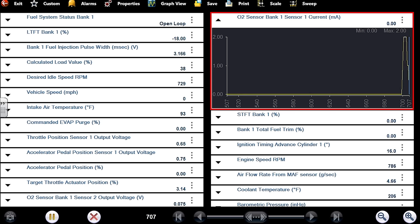This is 100% fixed. Let me reload the data. Tough calling a mass airflow — sometimes the unplug-it test isn't always your best friend. Not all cars have good default strategies, and it's not perfect. But I unplugged it and it got so much better — that's a good indication you have a mass airflow problem.